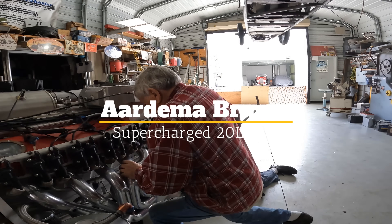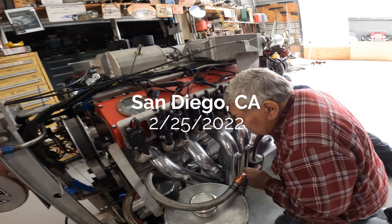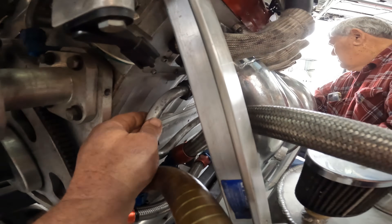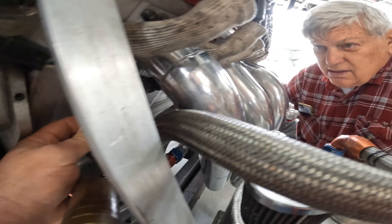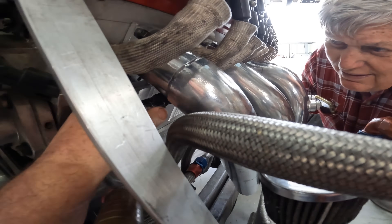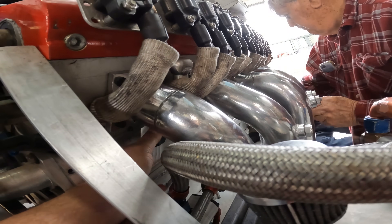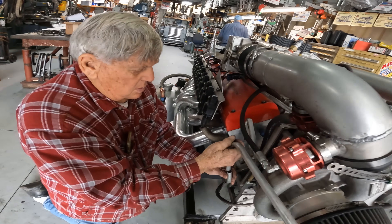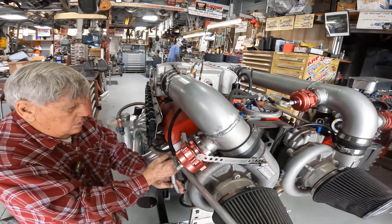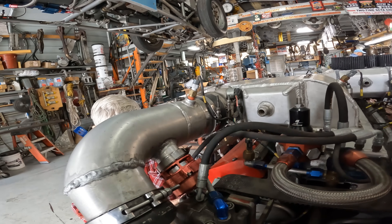Over the last few weeks, Pete and Kevin have been working on getting their 20-liter supercharged, hand-built V12 engine up and running after several years of hibernation. This is one of Kevin and Pete's bizarre homemade engine designs, originally intended for use in an H1 Unlimited hydroplane. The development of this 20-liter V12 included the help of Kevin Ailsworth and Jeff Johnson. This massive gasoline-powered beast measures nearly 1,200 cubic inches of displacement with a 5-and-5/8-inch bore and a 4-inch stroke.